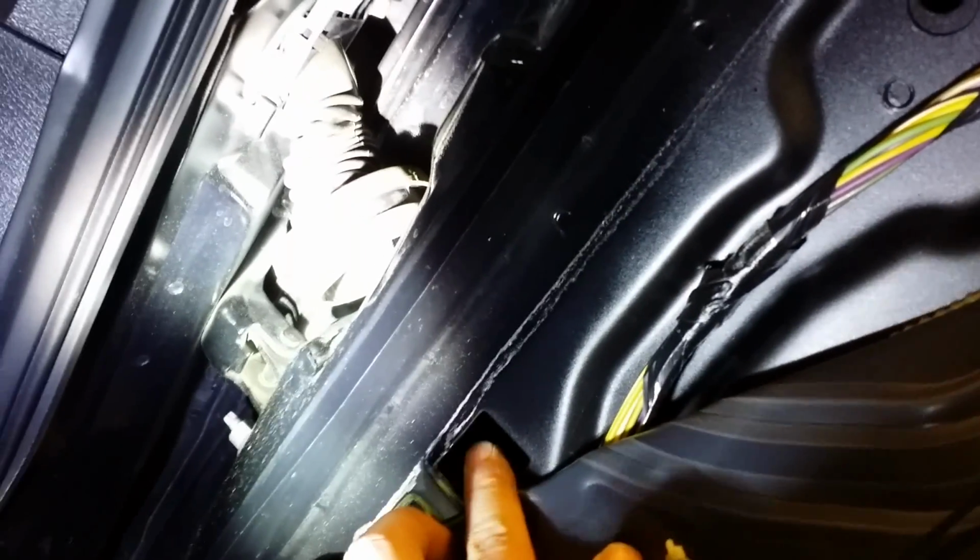Once the housing is reassembled, your bolts are retightened, and your harness is reconnected, you'll take your new power wire, pull back this black layer here, run it along this harness until you get to this open square in the frame here. You'll run your wire through here and out to the door jamb where you pulled this rubber grommet off. All you have to do is tug it a little.